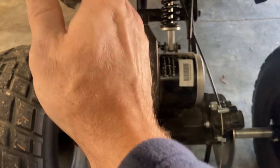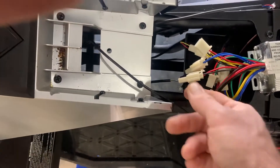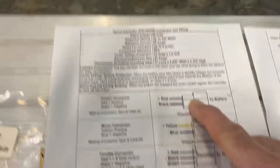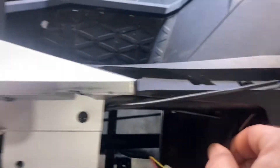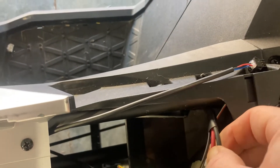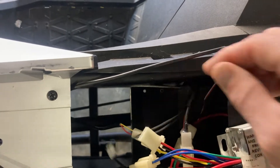I did not hook up any other options. There were some cables I didn't look into or investigate and just don't think you need them. The motor connection is a big cable that actually has two cables inside it. There's a smaller secondary cable with two leads — I don't know if that's for overheating or speed sensing. I didn't use it and it works fine.